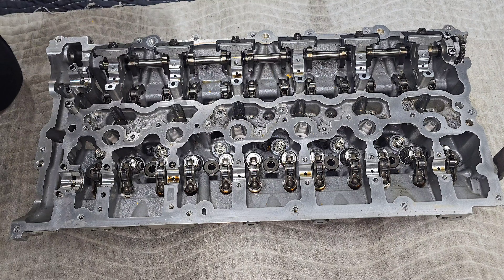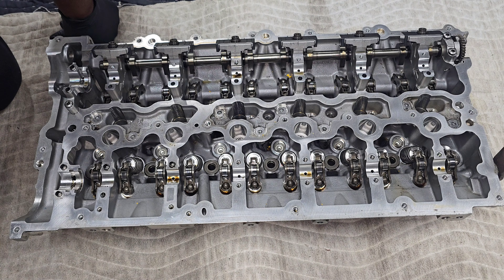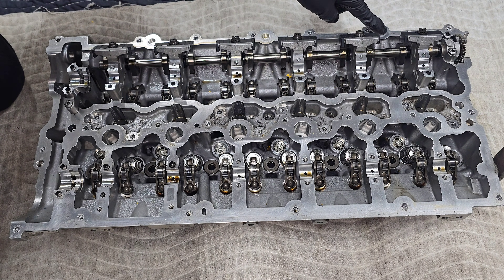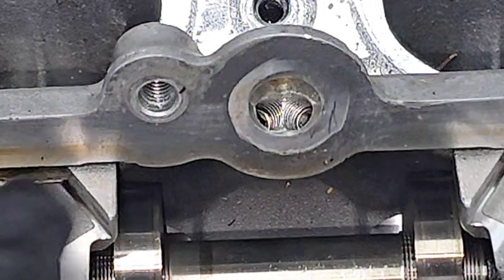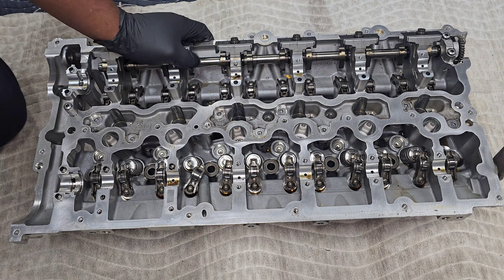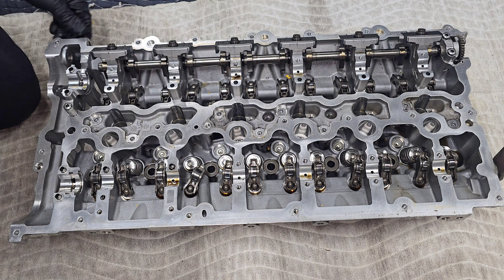Of course we've got four valves per cylinder — you can see four valve springs, four rockers, and it has hydraulic lifters, which is pretty standard for any modern German car. I pulled this off to get an overview of what's going on. We've made multiple videos on this with the valve cover removed doing PCV things. The other thing I haven't touched on is we have a crankcase vent — three head ports on this side that are all tapped and blocked off so no airflow can get into the cylinder head through the PCV system. There's also an extra vent on the other side.